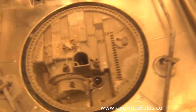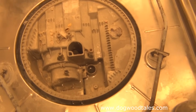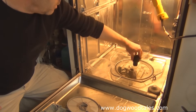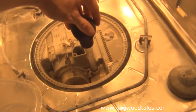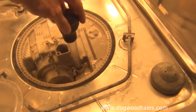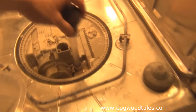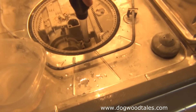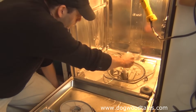As you can see, there is some water down in there. We want to get that water out — this is where the turkey baster comes in handy. Get the water out from the bottom, because all the water from the top drains down here, so there could be quite a bit — several cups. That's just what's left over from the dishwashing cycle.